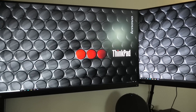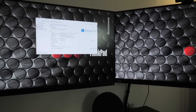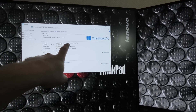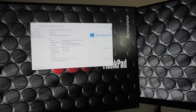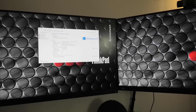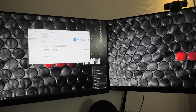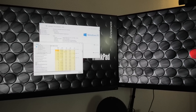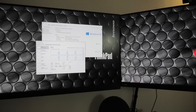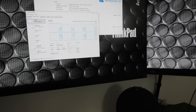Let's check what it sees for RAM. We have 12 gigabytes of RAM, and the CPU I upgraded this one with: the E3-1275L version 3 at 2.7 gigahertz, four cores. It actually has hyper-threading as well, so if we check performance, we get eight threads. That is nice.